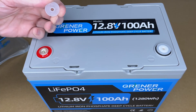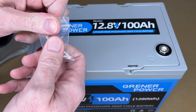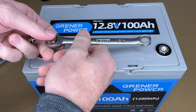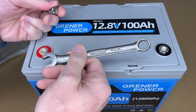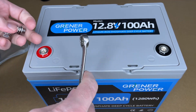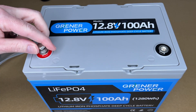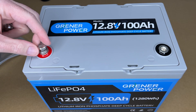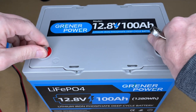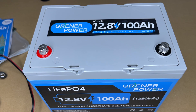There are protectors on the terminals — let's unscrew those. We have positive and negative, and two sets of bolts. These use a 13 millimeter wrench. I don't like to use long wrenches that can bridge the terminals; an insulated wrench is probably best. Even with a short wrench, I hold it off to the side to avoid bridging. I didn't see a torque spec in the manual — it's probably around 10 newton meters or so. I'll screw these terminals in — not cranked down super tight, but in there pretty firm.